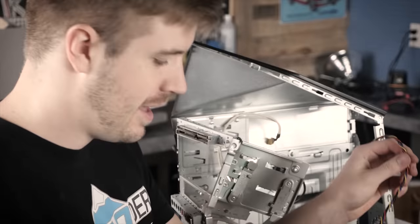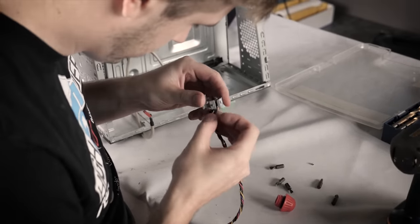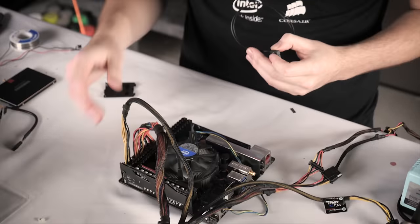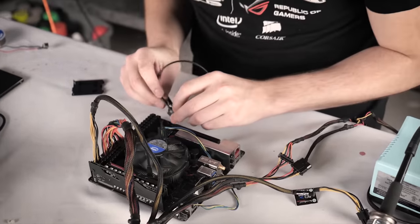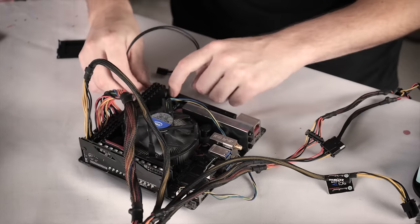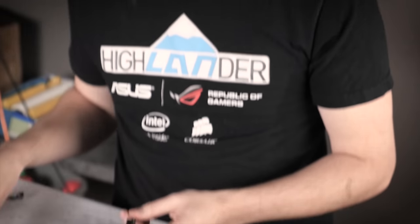While I'm salvaging this computer case and ripping out its switch to use for something else — so if that's not Fallout, I don't know what is. I just need two of the wires, only the ones that go to the actual switch itself. One thing that's really cool that I got for this build is this tiny little low-profile SATA cable, although the SATA connections on this board are right next to the RAM, so it's kind of a problem. But if I put it in the bottom slot and work the cable around the bottom of the RAM but above the PCI Express slot, I can kind of make it come out just fine, so this will work for my SSD.